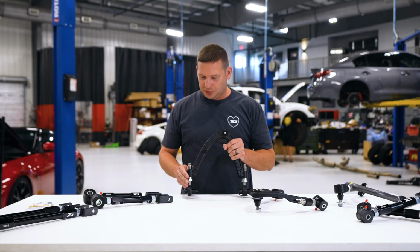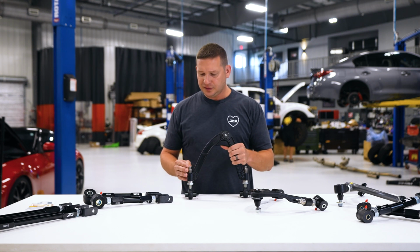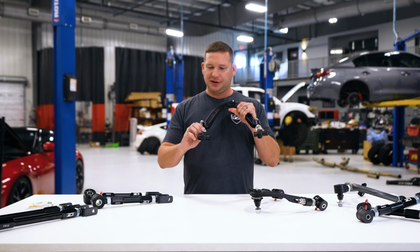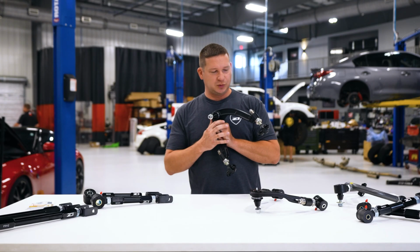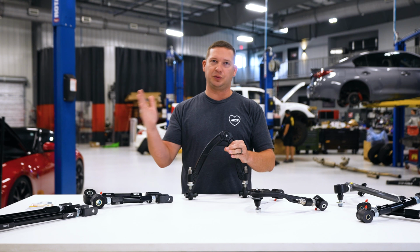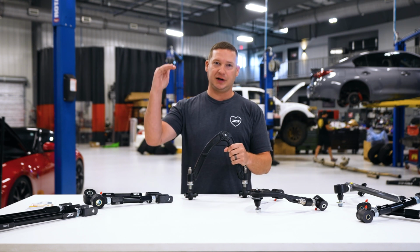So our guys have gone to work to make these double adjusters very easy. They're stainless steel. They feature a jam nut to keep the joint in position and tight in the threads, and then they have some Allen keys on the bottom that clamp the body to lock the adjustment itself as well. The nice thing here is you get about 3.7 degrees of total range of adjustment from where you're starting static at most heights if a car is stock or slammed.